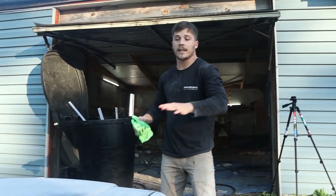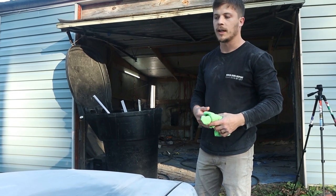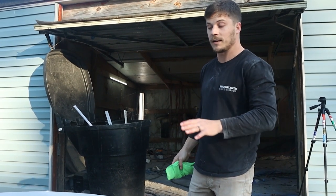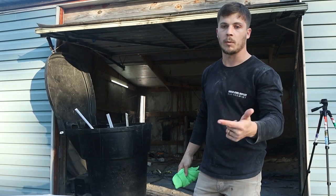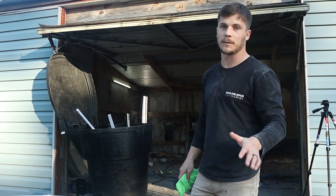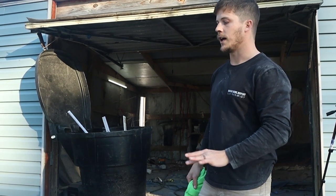All right, so you've got to clean the car before you paint it. That seems pretty obvious. You don't want dust in your paint, even your primer. You want the smoothest finish possible, but the issue with this is that water is the enemy of paint. You'd think dust would be the biggest enemy, but in my opinion, it's water. If you get water in your lines, or water in the paint from the ground, or if it comes flying out of the door jams and into your paint, it's gonna mess up your day. It's very difficult to fix, especially in the clear coat stage, but even in primer.